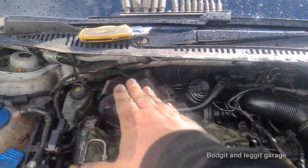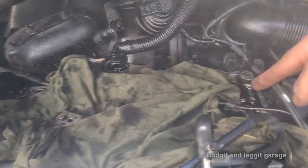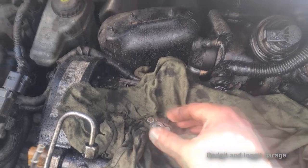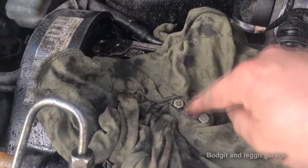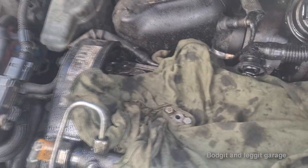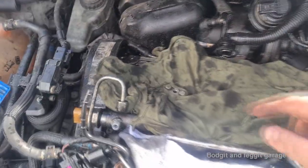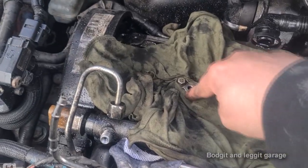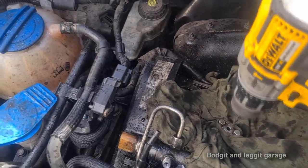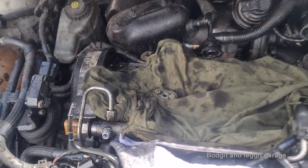I've had to take that metal panel off here to get the drilling because otherwise I couldn't get in there. I've cut the hole out where I want to drill. I'm drilling 20 mil down into there at least — that's where the bolt is broken. This is all part of the actual head, but there's no point taking it off because I can use this as a guide. The drill bit fits in there absolutely lovely — a perfect guide so I know I'm drilling absolutely straight.